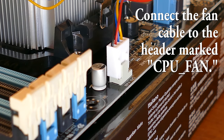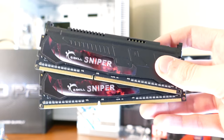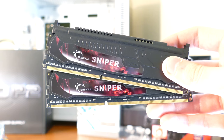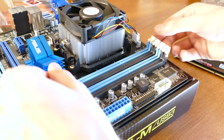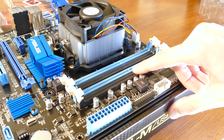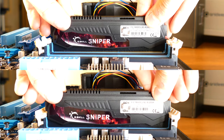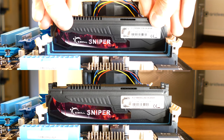The last thing we need to knock out here is RAM installation. G.Skill provided 8GB in two 4GB variants of their Sniper Series DDR3 running at 1866MHz. These DIMMs are linked in the description and come highly recommended. Referencing our motherboard manual, we need to install these modules into slots 1 and 3, so pull back on their locking mechanisms, orient each module per the notch in each slot, and use force to insert each. The clips on either side should snap into their locking positions once they've been properly secured.